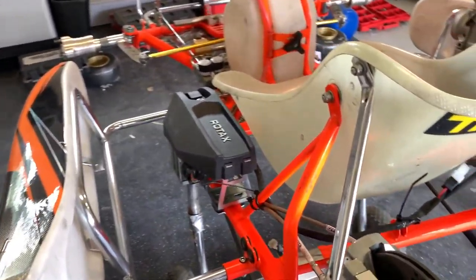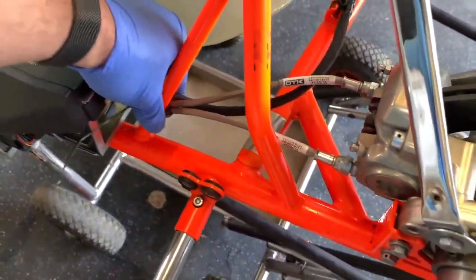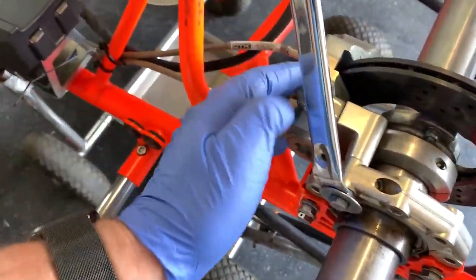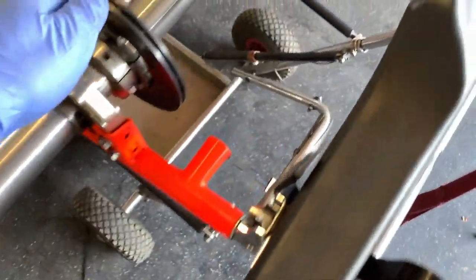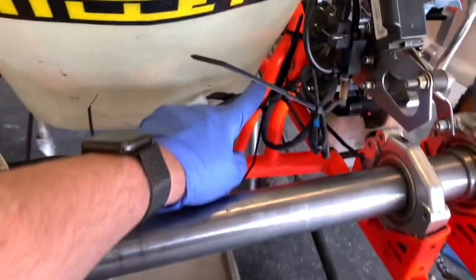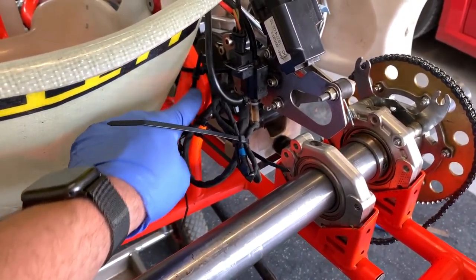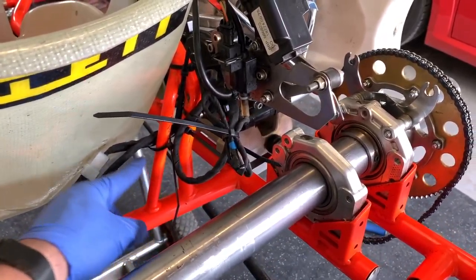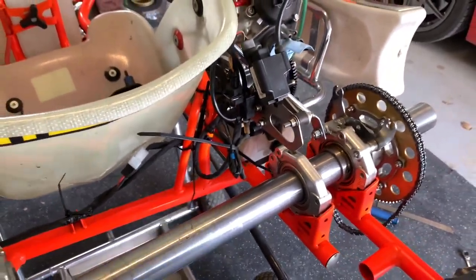It doesn't look too pretty but I'm just going to leave it like this for now. I've got just the one brace mount here. These brake lines don't get hot, but this can get very hot, so I want to keep some separation — keep that load separate. I used that little pickup there and then braced it over here. One little trick: I put a tie in vertically here, clamping up and then tying it down so these cables don't settle onto the bottom — I'm afraid of them dragging on the asphalt. Just lifting them up off the chassis a little bit should do well.